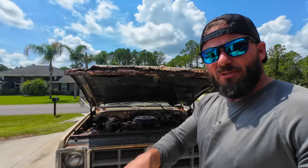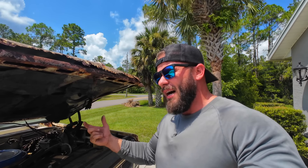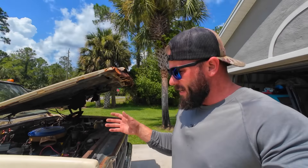I'm going to throw these on real quick. And while I'm doing that, I'm going to go ahead and try to bleed some of these brakes. We probably got air trapped in the system. When I popped the master cylinder, I noticed that the reservoir was a little low, so I'm thinking we sucked some air in there. That's why we got some spongy brakes. But we got some brake action, just not enough.